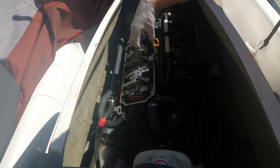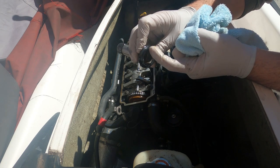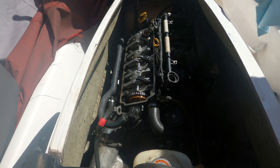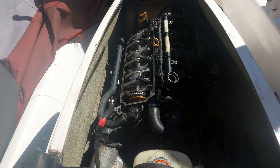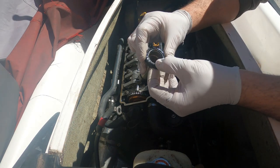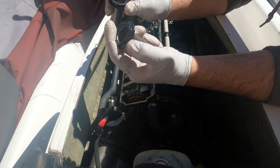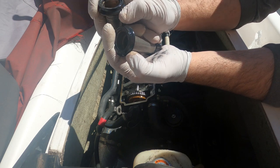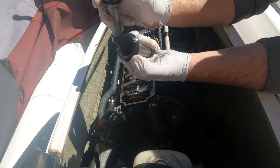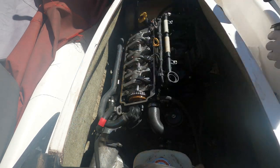The tubes come out very easily — just pull them out. As you can see, the seal on the top one that was stuck to the cover is completely dry. The lower seal is also very dry. One tube is pear-shaped but still dry with paint on the edge — that's why there was oil leaking everywhere. Comparing them: the best one still has a little flexibility, the middle one is more stiff, and the worst one is completely hard. We're going to replace all three.